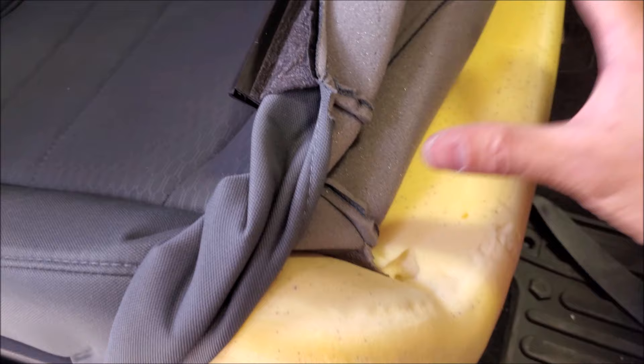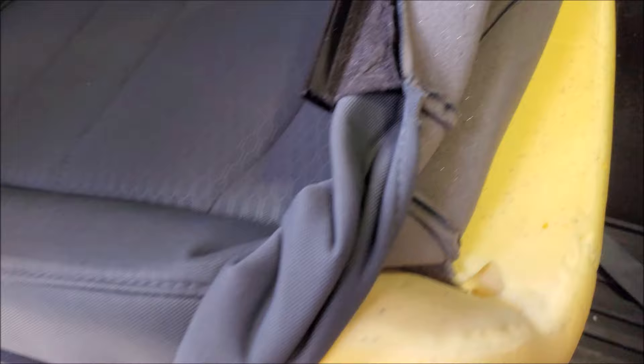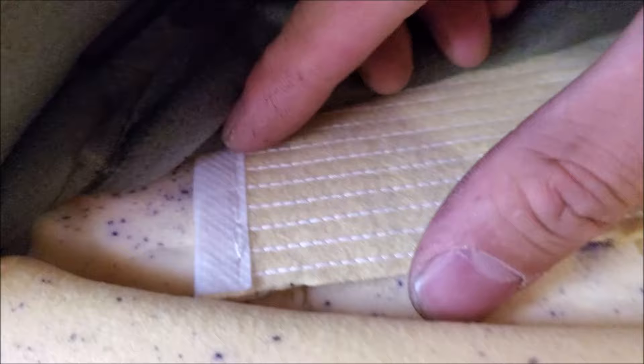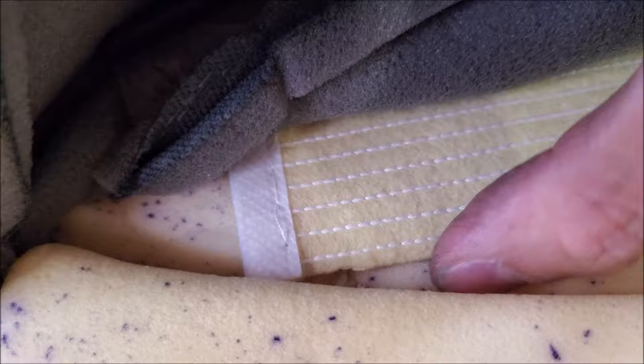The RAMs are pretty forgiving — we do not have to pull the seat out of the vehicle. If you don't have enough room, you'll want to tape everything up and remove the seat. Next, you have to find all the hog rings and use mini bolt cutters to remove them. Then we figure out how long we need the heating element to be and cut it to length. When cutting, you can cut across the width only — do not cut front to back or lengthwise, because then the heated element will not work. Then run the wire inside the seat, and once you've got placement set, make sure it's as far back as possible because you have to put the fabric back and get the hog rings in there.